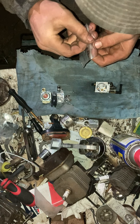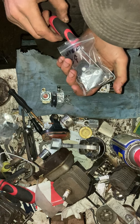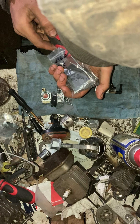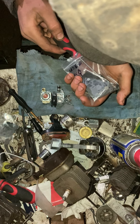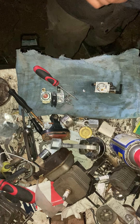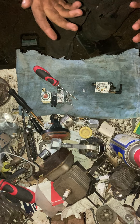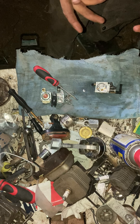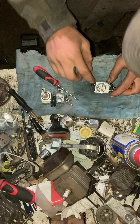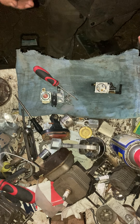Here's some spare parts — not used, just spare parts — this is what I did not use from those rebuild kits. Now, I know a lot of people like to seal their welch plugs with fingernail polish. Don't do that anymore, because most people run alcohol in their fuel — and by the way, do not run alcohol in your fuel. Do not use ethanol. The ethanol will eat everything inside, and that's the reason these diaphragms go bad.